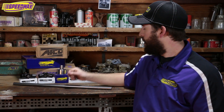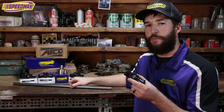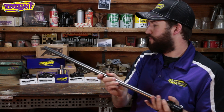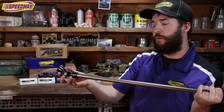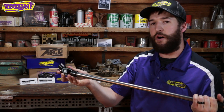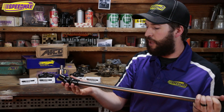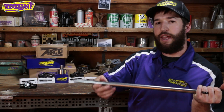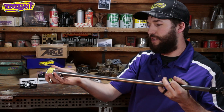The last knuckle we have is for the middle of the steering column. When you start building your column, you'll order the knuckle that is appropriate for your car and you'll take that and weld it on. The middle knuckle you'll want to place at the hole in the firewall where the original steering column went through. It is critical that you line up your steering knuckle before you weld it on. Then you'll take another piece of steering shaft, sit in your car where it's comfortable, and attach your steering wheel and your quick disconnect.